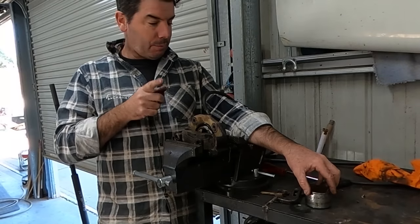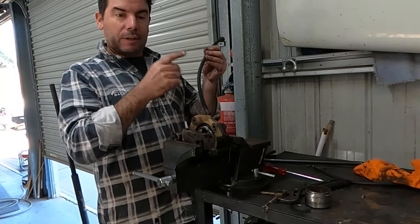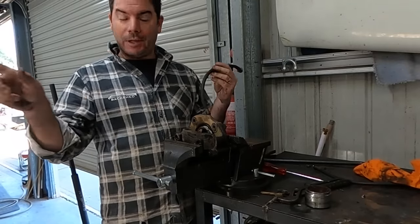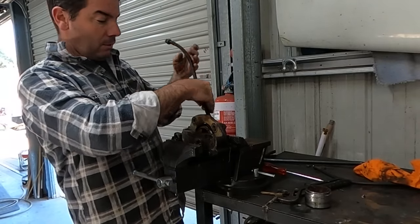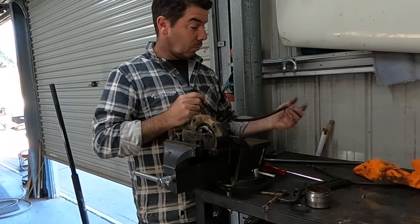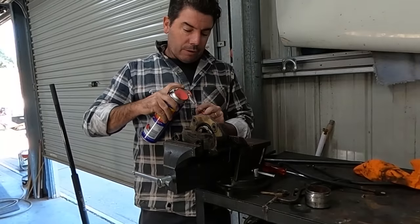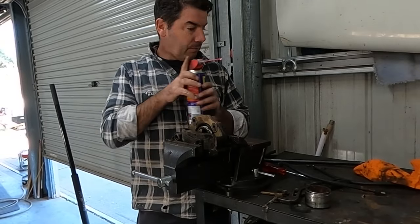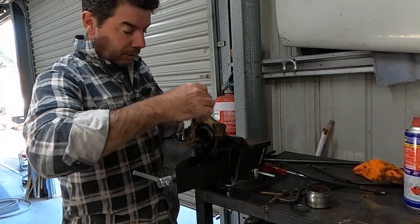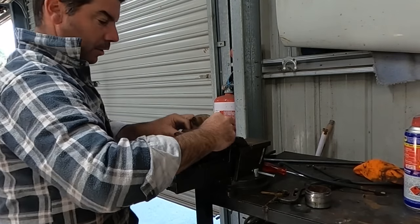And so I added a bit more and a bit more and a bit more, and then decided, well, maybe I'll take the hose off. Took the hose off, straight into the caliper, didn't turn my compressor down, and it popped out. So it turns out that hose was the only reason it wasn't coming out. So I'm going to take the hose off this time, fill the piston area with WD, and then, like I said, just rock that piston, see if I can get it to move, caliper back in, turn my compressor down, and then just blow that guy out again, nice and gentle.